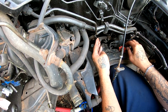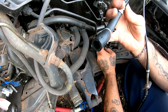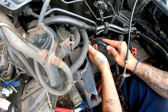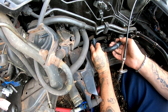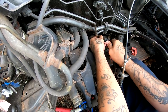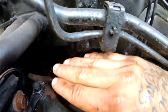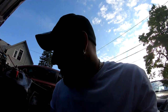Look at how clean cut these cuts are — they came out perfect. Now what you guys are going to do is take a hose and stick it in this guy. We're going to do this guy first because this guy is the one that goes to the reservoir. I'm going to put that guy in and we're going to top this off with fluid before we stick it into this guy. The last hose clamp just went on there — and that, my friends, is a power steering delete slash power steering loop.